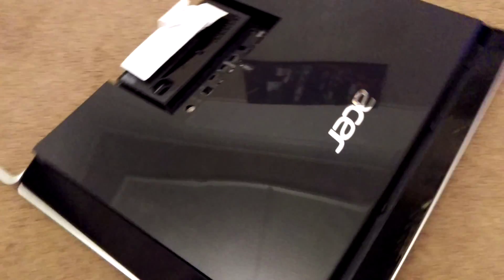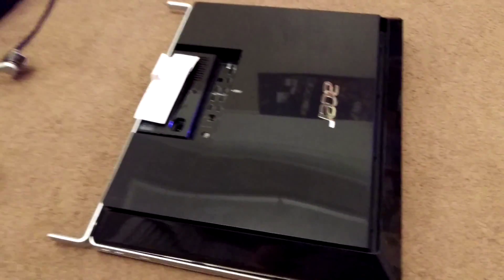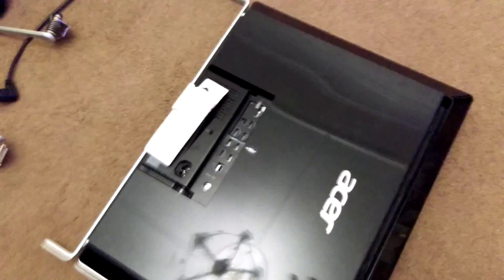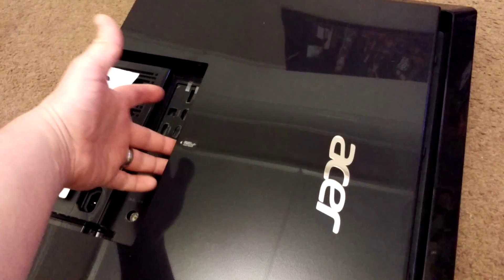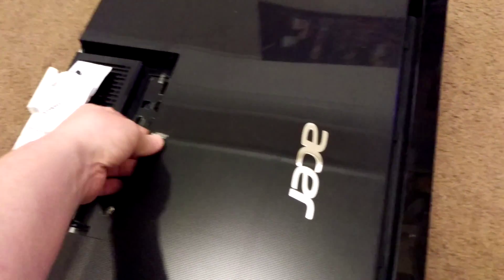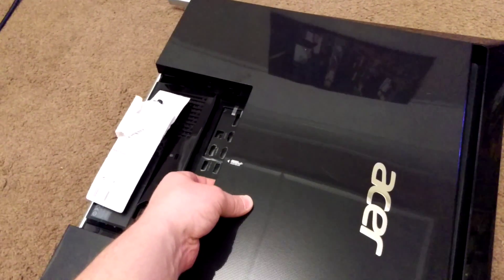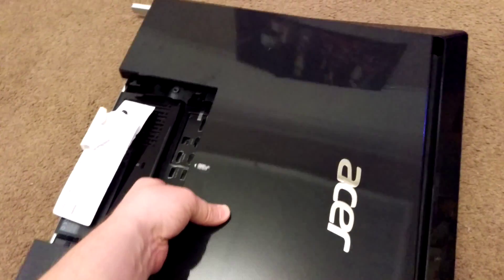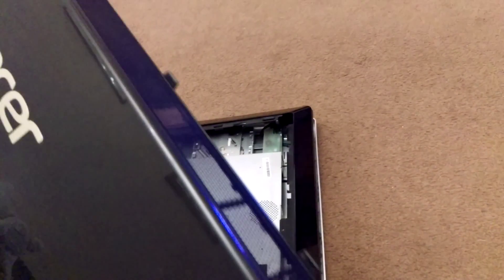This machine's already been pulled apart — you can see the stands over there. I'm literally about to put it all back together, so before I do, I thought I'd show you how to get into it from where all the ports are. If you literally just get this piece of plastic, you'll find that the two bottom ends will just prise apart, and if you pull down, that will just come away. You can see a couple of clips there holding it all in place.